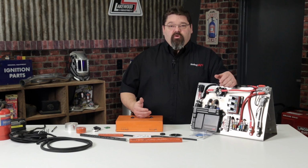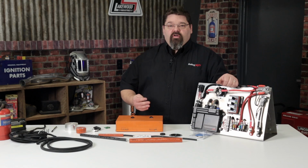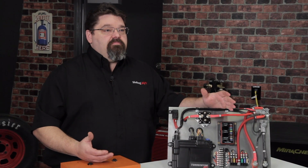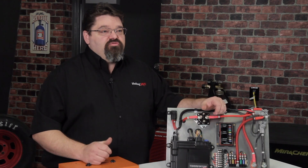As discussed in a chapter on proper wire selection, every circuit must have a wire that's properly sized for the component's electrical load, or you'll have problems with heat and voltage loss at a minimum. Serious component damage, including fire, are always a possibility if these rules are ignored.